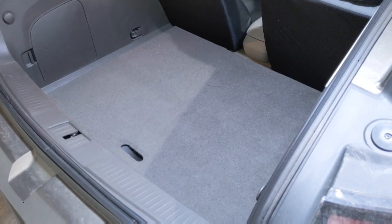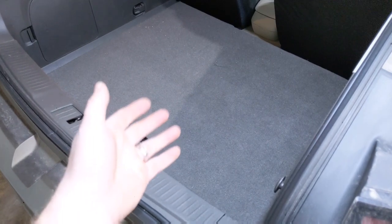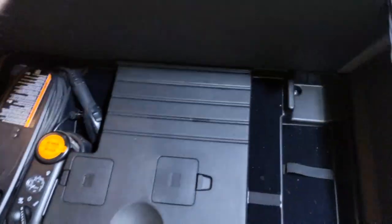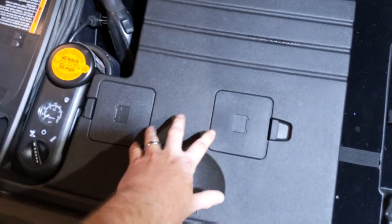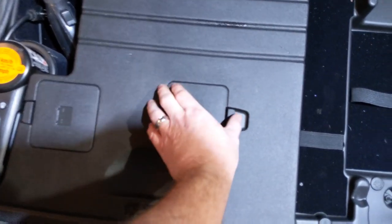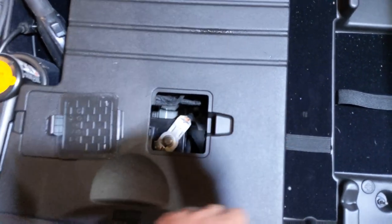We've already determined that the coolant pump is bad in this car, so we need to replace it. The first thing you're going to want to do is disconnect the 12-volt battery located in the trunk. Whenever you're working on these cars, you really need to disconnect that. It's underneath this hatch — GM has provided a fancy cord to hold the hatch up while you're working. You're going to see a couple of trap doors. I like to disconnect the negative side; a 10-millimeter socket will reach down in there and undo the fastener, then just lay it off to the side.